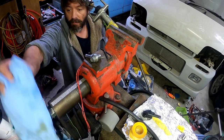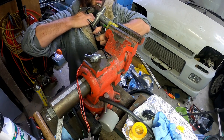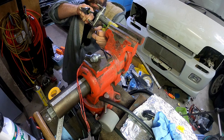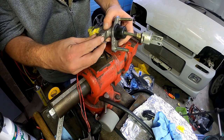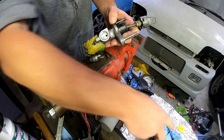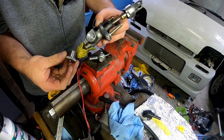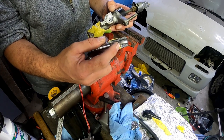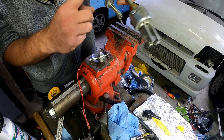It is actually cutting - very, very slow but it is cutting. How long have we been doing this? 28 minutes... 40 minutes I've been doing this. I might be at the end too. We've maxed out depth on the tap - the hole isn't deep enough to get the tap in far enough. This tap is tapered and the taper starts too late, so it's already too big before I even get to the thread I've created. There's just no chance for this to go in. Tapping with half-inch PT, while it looked like a good idea, was never going to work because the fittings start too far up on the taper.